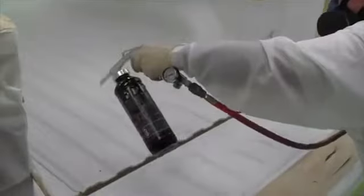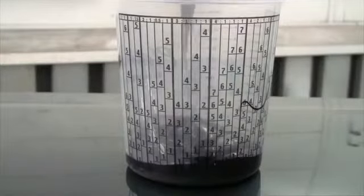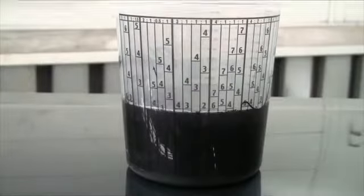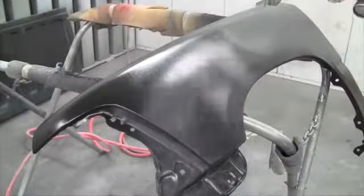Achieving a different look or texture is very easy. All you do is increase or decrease the distance from the surface, change the gun speed, or adjust the air pressure. As a final example, using a Gravity Feed HVLP spray gun, I'm going to apply Raptor to this fender so that you can see the types of texture that you can get. This makes a very durable, protective coating that is very popular with 4x4 ATV and off-road vehicles.